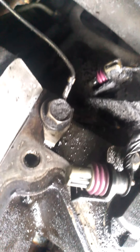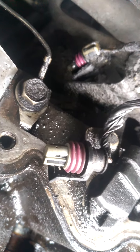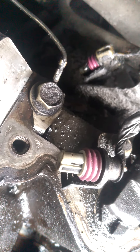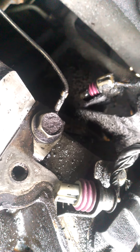Look at all that kicked-up oil — now look on top of the transmission. There's no way a rear oil seal will leak on the top part of the transmission. I already changed the oil pan gasket along with the valve cover gasket and it was still leaking, so it's coming from the top, sliding down on top of the transmission and going around the sides. This is the rear — this is where the engine oil pan ends at the bottom.